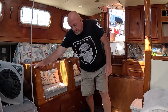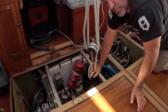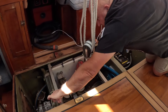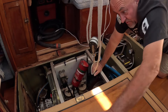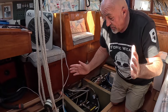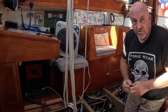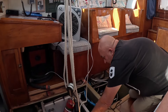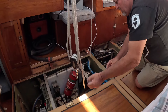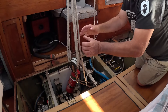So here's the problem. This frame was replaced when the engine was put in, and there's a gap here and an even bigger gap here — I can put my finger in. The frame is bent down, so whenever you walk on this floor panel it goes ka-dunk. I'm going to try and use a small block and tackle to bend this frame back. I'll leave one floor panel in so I can tell if it's straight.